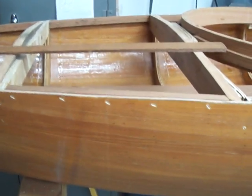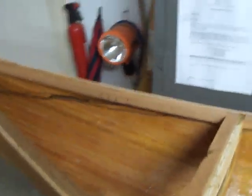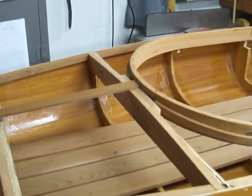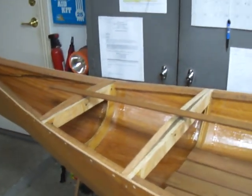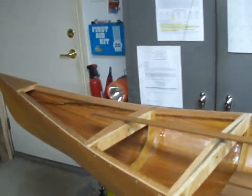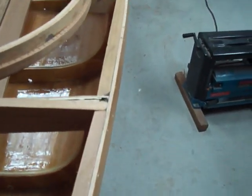All along the side of the boat, I had to fit these pieces in here because when I go to put the deck on, I'm going to start in the center. If I don't start in the center and come straight across, the ends would want to float. By starting in the middle, I always have somewhere for my ends to be fastened down. I'm going to basically just glue this deck down and might put a few nails in it, but not too many because I don't want to mar the surface. I plan to get it glued and fiberglass it all together. I put these side pieces in there all along the boat in between each one of the deck ribs.